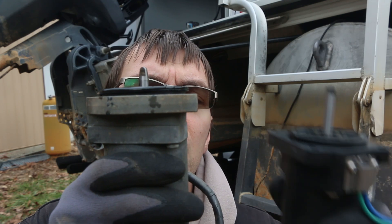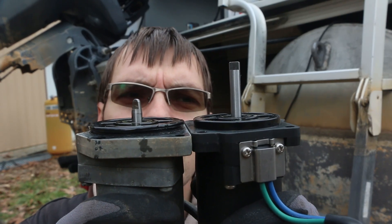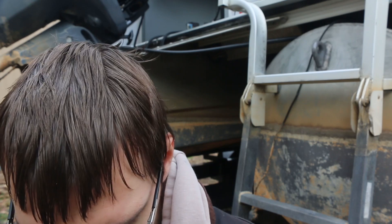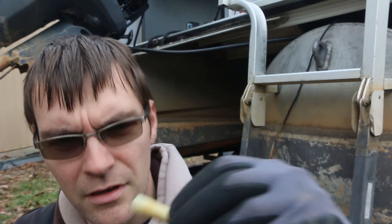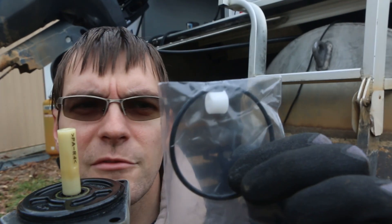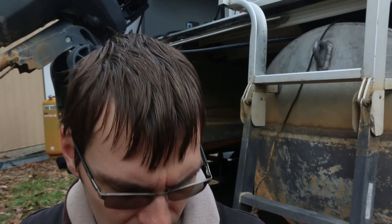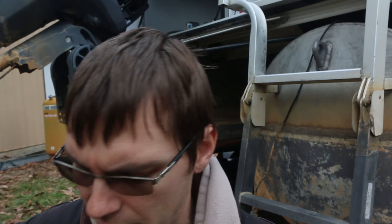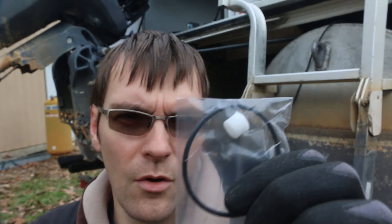If you compare our old motor to our new motor, you may notice there is just a little bit of difference, but that's okay. The old motor uses a big long plastic coupler that sits on top. Our new motor comes with a little short coupler. That makes it more universal because Yamaha switched to the longer shaft motor and the shorter coupler later on. So this is upgrading the old long-coupler style to the newer short-coupler style.